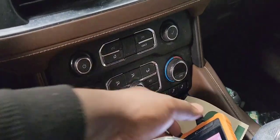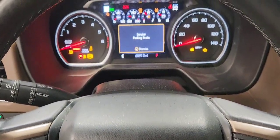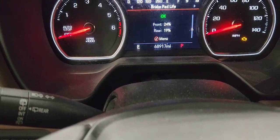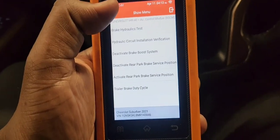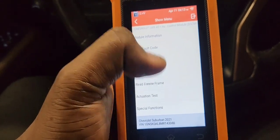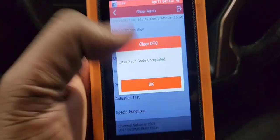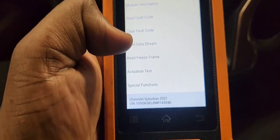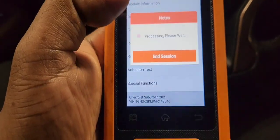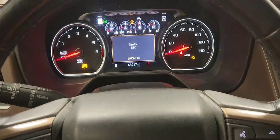We're back in the vehicle now — the brakes are replaced. We're going to put the vehicle on, but don't start the engine, just put it in accessory mode. It's telling you: did you install new brakes? Say yes — 100%. This is going to set a few codes in the brake control module. The idea is to go back and clear the codes first, then calibrate the parking brakes so you can take it out of service mode. Let's clear the codes and then go to deactivate.